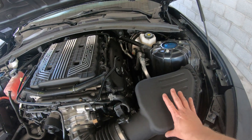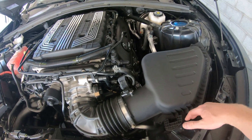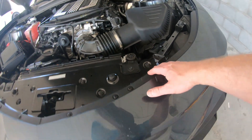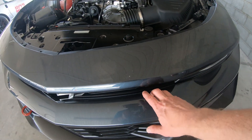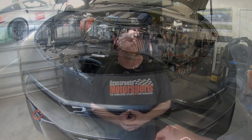The factory air box, however, is completely sealed. It's a plastic air box with a gasket that seals to the snorkel that is behind the driver's side headlight, so it is only getting outside air into the air filter.